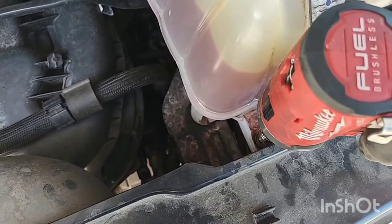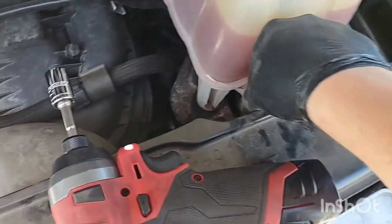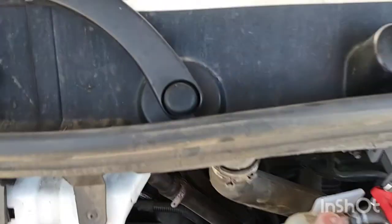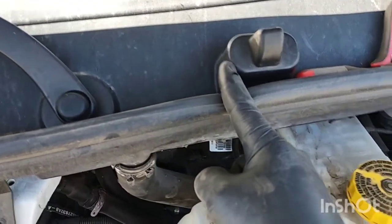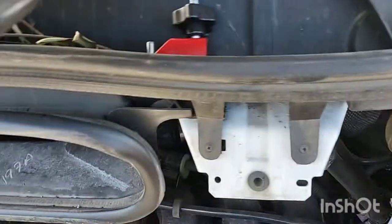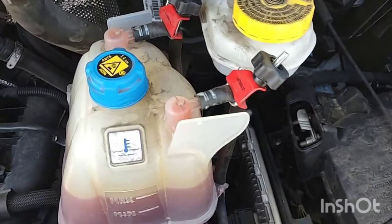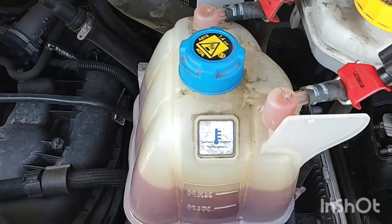Once you get both those clamps off, take your 13mm on your impact and come right in here to unscrew that bolt. I'm using the cowl area to store stuff, but just be careful — you can see where this hose thing is, it's a little drainage port with a hole there. So make sure anything small isn't between the wiper blade and your washer sprayer. I'll just set this bolt up here. Also, I threw some cardboard down on the ground below the van so that if anything drips, it'll land on the cardboard and keep the area tidy.